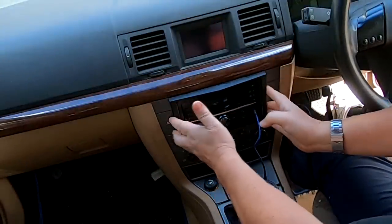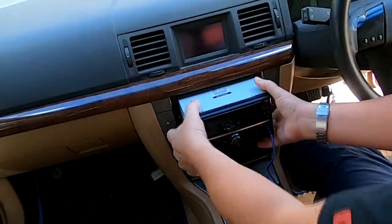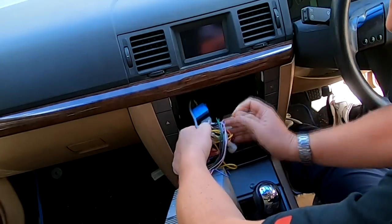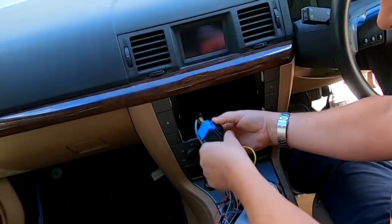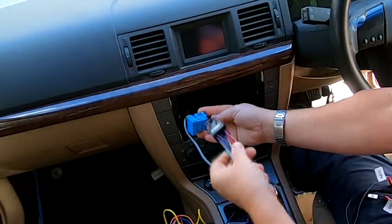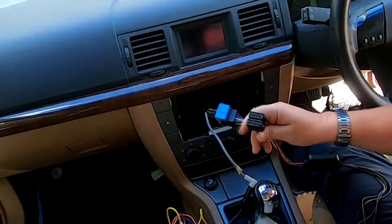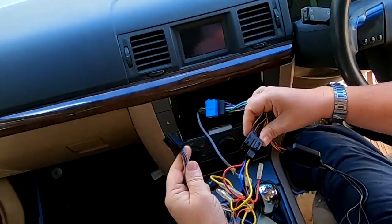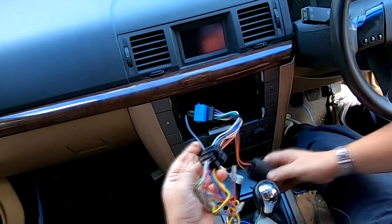This is the radio in question — we haven't quite got the right surround for it so we had to stick it on with some double-sided tape. Let's get that out of the way. There we go, let's pull it out of there, and on the back here is the original loom — I need to pull these two connectors out. That's the area we haven't got to touch, and our new piece will connect into this bit here, so that just marries up with the original and should just push in. Now we've got these two sockets which click into our existing — they're colour coded so there shouldn't be any worry about getting them the wrong way round. They can only go in one way really, it's a straightforward job. Just make sure they're fully pushed home.